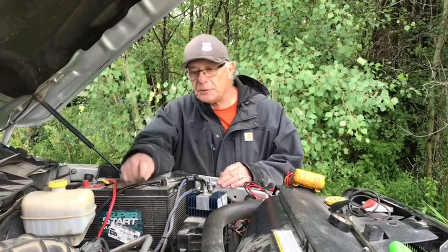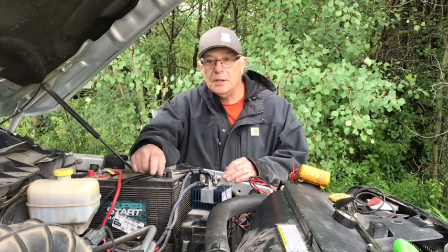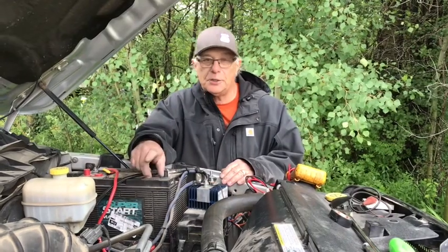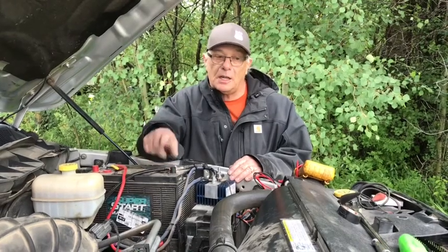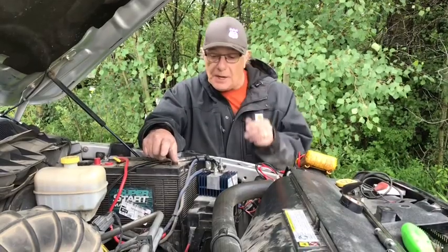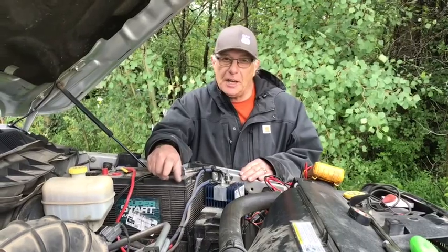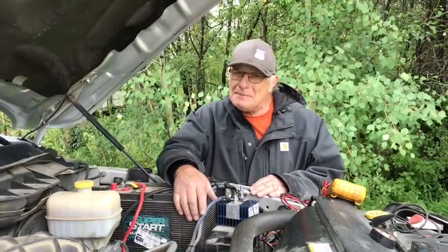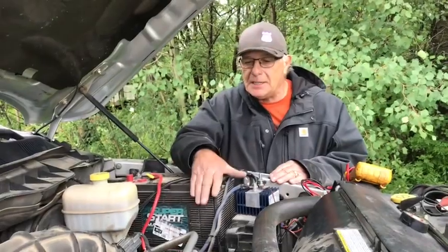Just remember, this is a 160 amp alternator, so this is like an arc welder. There's one bigger than that, a 200 amp, but then you have to change belts and pulleys, and I didn't want to do that. A 160 amp alternator is as big as they put on Class 8 trucks, the big Kenworths and Freightliners. So this is a pretty hefty alternator, about half the size of a Kenworth alternator. How many years would it go? We got 7 out of this, so I'm thinking we don't push this baby too far. Anyway, that's done. Simple job.